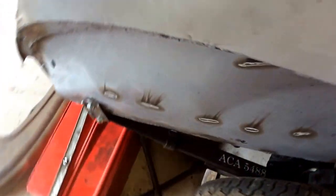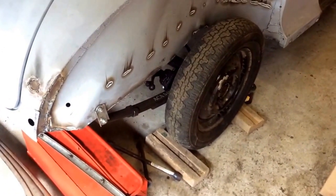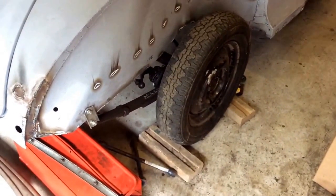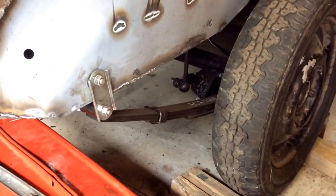Suspension is all painted up and shiny, and it went together quite well. One of the torsion bars — I can't really show you underneath — but the end had to be cut off. I built it up with a weld and got a 12mm thread put into it, so I'm quite pleased with that. Repair rather than replace.